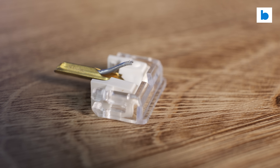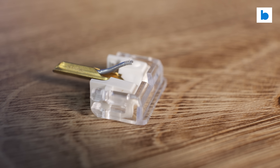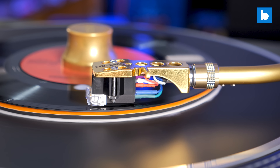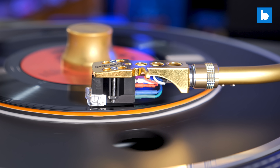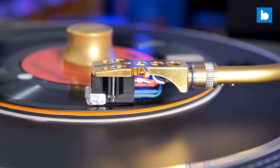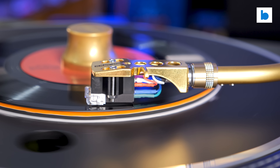The theory goes that the metal shank in a bonded assembly increases the mass of the stylus and therefore reduces the overall responsiveness of the stylus to transients. So a nude stylus will generally sound better than a bonded one. It also means that the stylus should last longer. There's more diamond to wear out and tracking should be improved as it digs deeper into the groove. The only disadvantage to a nude stylus is cost. They typically cost more to produce than a bonded stylus, mainly because diamonds are, you know, expensive. And we'll come back to pricing towards the end of this video.